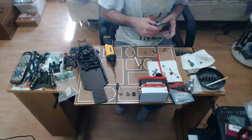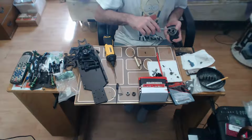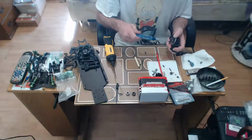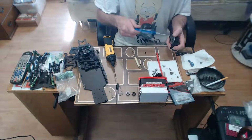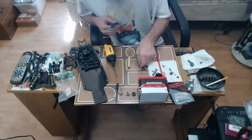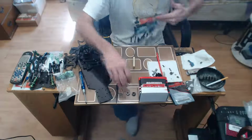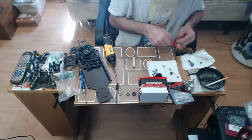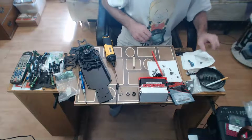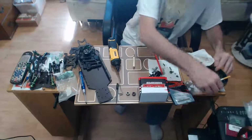So that 0 degree helped keep obviously the toe at 0 degree in the rear, and life was pretty decent. But yeah, the soft RPM plastic tranny cases, the plastic is a little bit more flexible because it's a little bit softer. And the heat of the gears and the tranny and the bearings, I just wasn't thinking in the long term that was going to prove out to be very beneficial in terms of consistency and tranny consistency, keeping the gears from blowing up, that type of stuff. Because that's gonna happen. What did I do? Losing my brain some days.